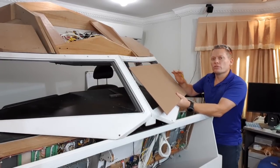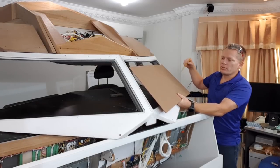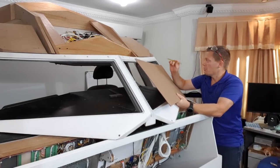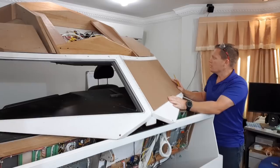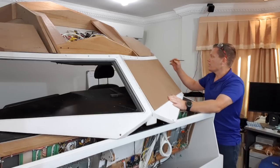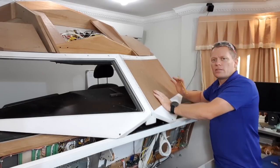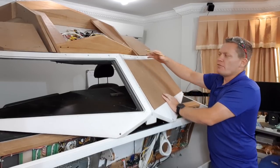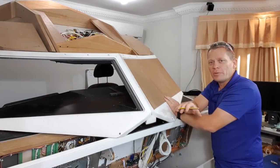Starting with the front-left windshield, I made a template first from the sizes in CAD Fusion 360 and gave this to the glass manufacturer. I'm not ever too sure in the UK about getting the corners rounded, but it's a lot simpler to ask them to do sharp corners and it's a lot cheaper. So where we've got rounded corners here, when I apply the template we do actually need to chisel out some of the corners just to allow the glass to sit flat. I made the glass two millimetres smaller in every direction to allow for any misalignment.